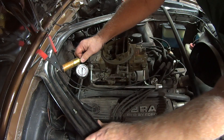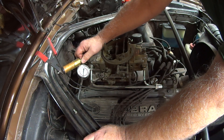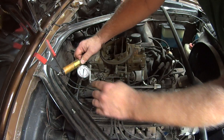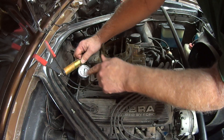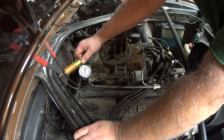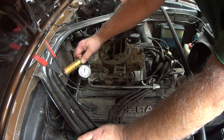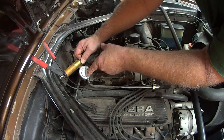The vacuum is bouncing right around 10 or 11 inches. What I don't want is manifold vacuum at my vacuum advance causing the timing to go up and down — that makes all the variations in idle speed even worse. Because the cam is slightly radical, it's enough to cause that variation. A stock cam would be idling up around 18 inches, but because of the lack of vacuum at idle, I use the regulator to stabilize the vacuum.